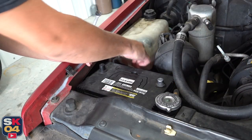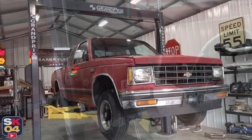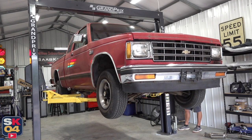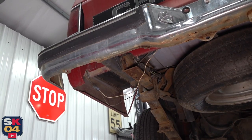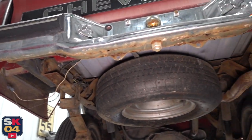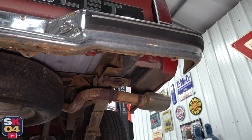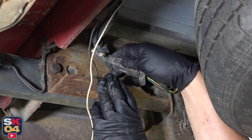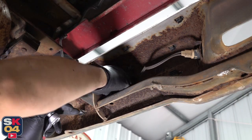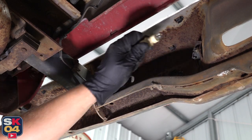With the battery disconnected, we can get the truck up in the air. It's really easy to take the bed off one of these things. The wire harness that ties in all of the rear lights is connected through the left side frame rail. You don't have to disconnect everything, which is nice. You can undo the main harness for the bed — like the taillights, backup lights, and whatnot. There's a few wire holders you have to take off, and you have to pop out the license plate lights. Basically, anything that ties the bed to the frame — the vast majority of stuff is going to come off with the bed.